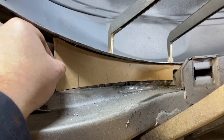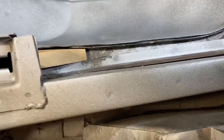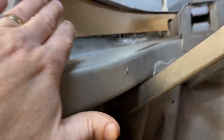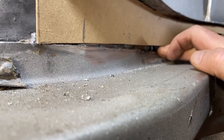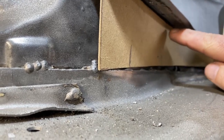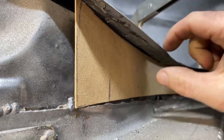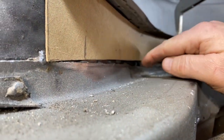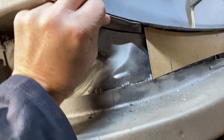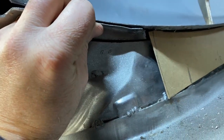Making progress. We've got a piece of cardboard in here that I'm going to use as a template. It stretches around to this side and it's notched over the top of the axle bump stop. I need to add a little bit here — about an eighth inch, three sixteenths of an inch. I think that will fit in well. I will need to fabricate a small lip, maybe a half inch lip, so it comes up and comes out and then these attach here. I think that will work nicely. And then I will fill this — it won't be this big — but I will butt weld it into the side of the frame. Not perfectly original, but pretty close. True to fashion. And I probably shouldn't have cut that off. I will probably clamp that in place and weld it back in, which is not a big deal.